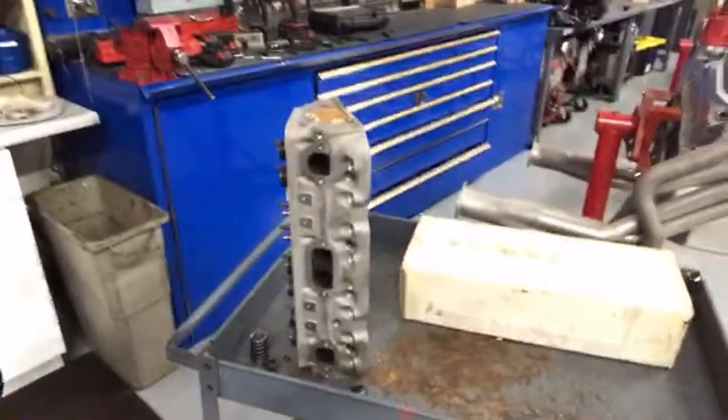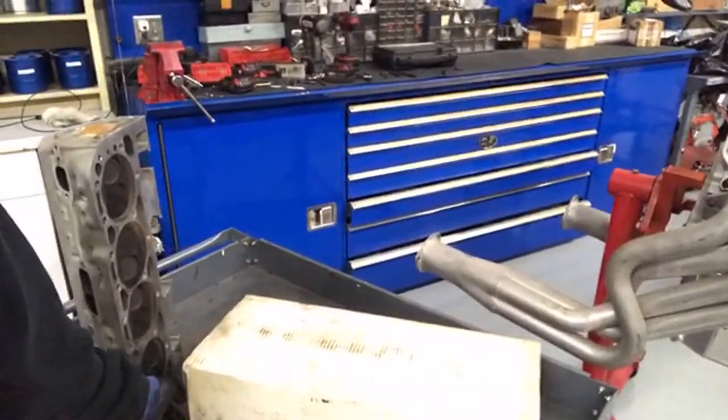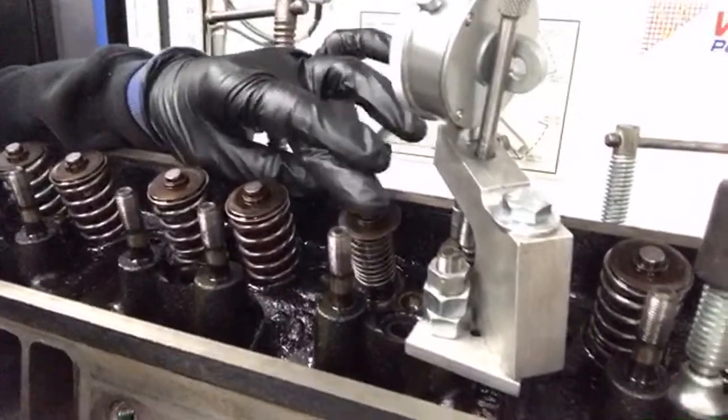I want to check both of these heads — this is an LT4 and in this box is our factory LT1 head. What I'm going to do is put the LT1 head on that motor over there now that I have the head off and can actually actuate the valves up and down. We'll put little checker springs on them so we can go like this, set them on the motor on the dowels, and see if that bigger valve will actually fit on that small bore. I'll do it for both the LT1 and LT4 heads.